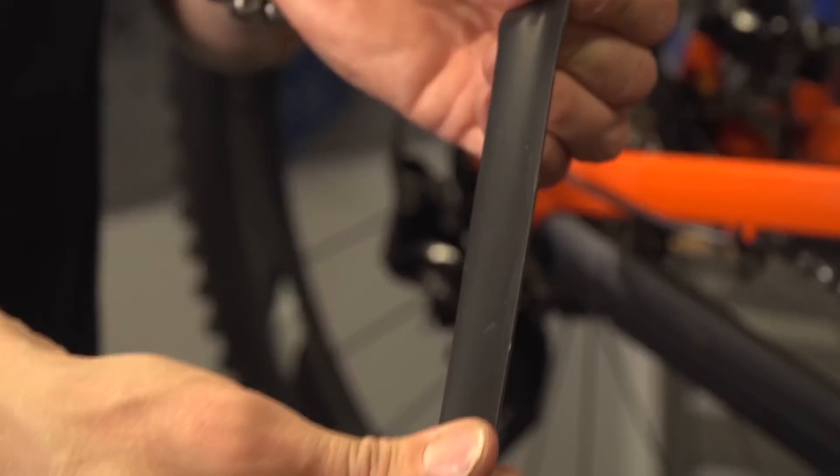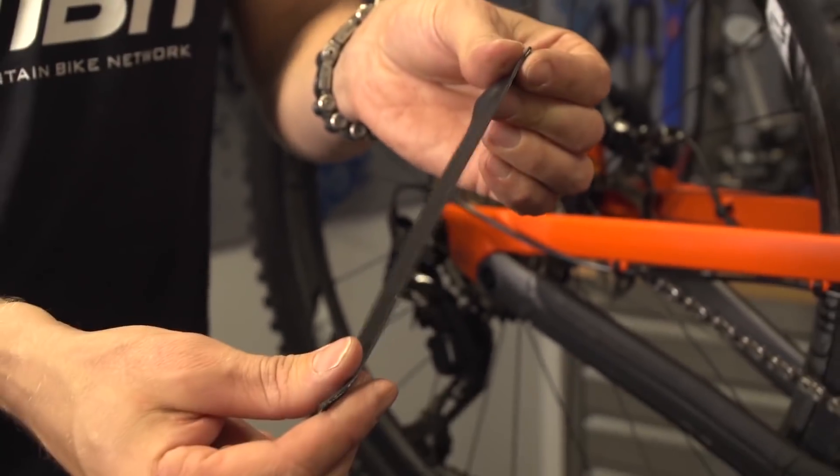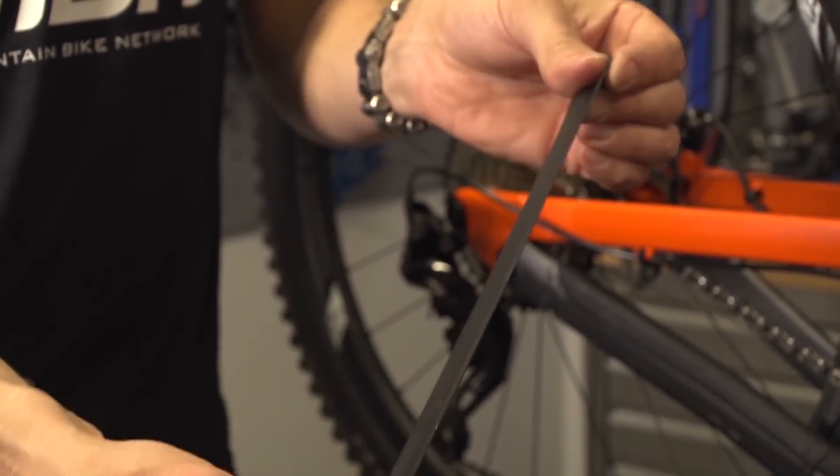More importantly, what's going to happen is that paintwork is going to continue to just flake off, so you really want to address that as soon as possible. Whilst you do that, inspect it and make sure there's no chance of an actual crack under there, especially if it's a carbon frame. You can do this fairly simply with some clear lacquer or top-up paint, but I do recommend having some protection on that down tube — whether a dedicated protector, some inner tube material, or something like 3M rubber mastic tape, which has a nice dampening feel.